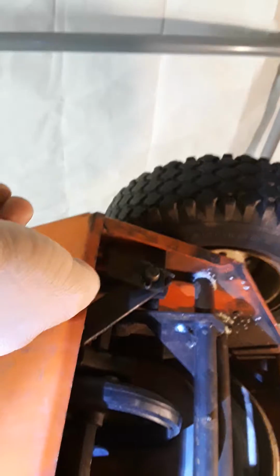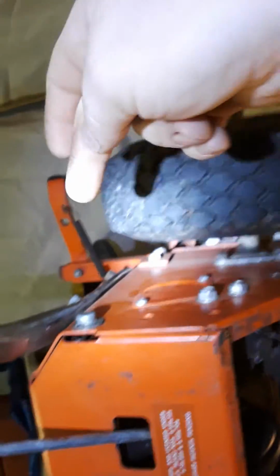So then you put the new friction wheel assembly with the new friction disc back up in there. Get that bar hooked up onto the top up there. Get that little bar hooked back in. Put the cotter pin back in, and use a new cotter pin if you have to. From there, okay, sorry about that. This piece slides back in through the friction wheel assembly. There's a hole that it slides back in. You put this clevis pin back in, boom.